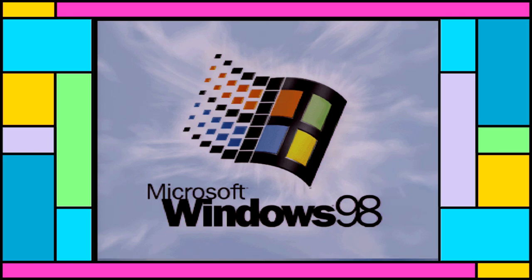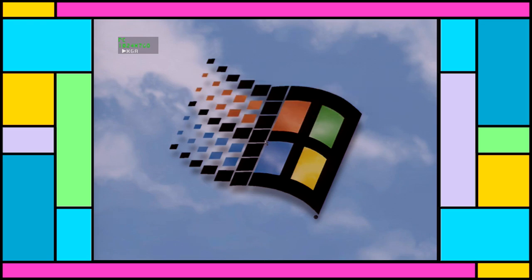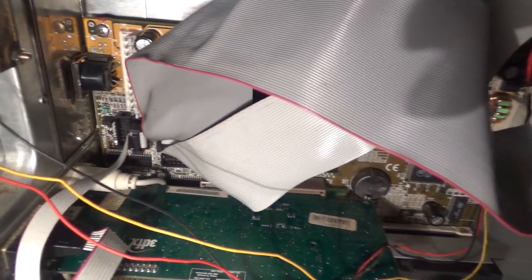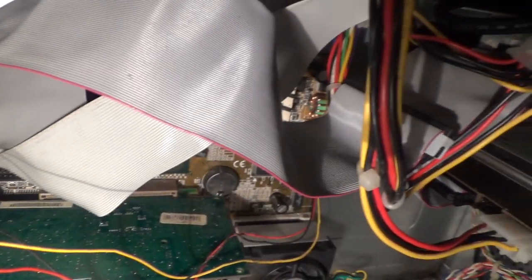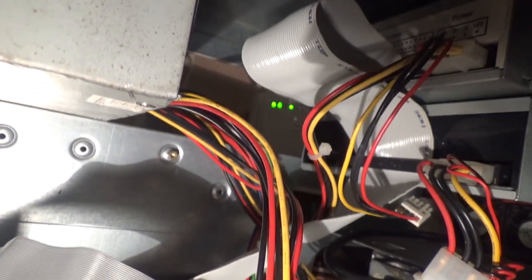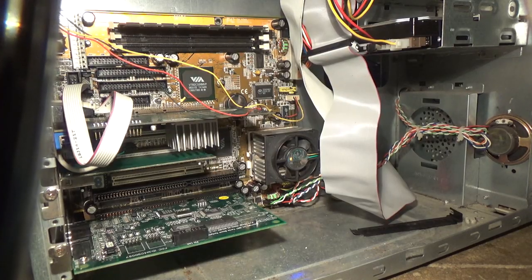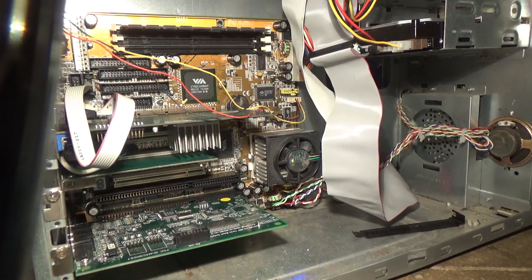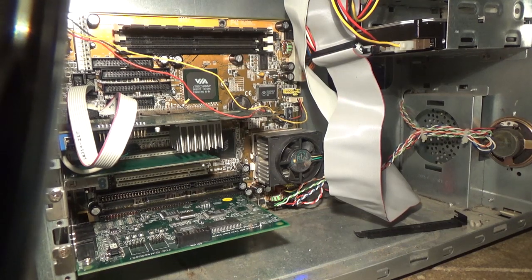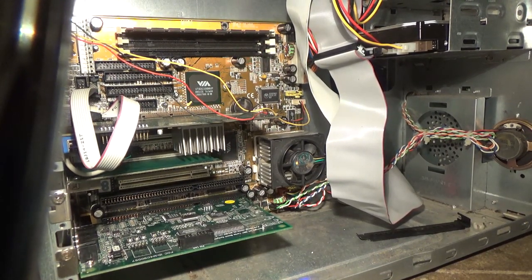Again, that's nothing eventful. Usually, but it means it's beating the TMC again, because that really didn't like booting operating systems. Actually, yeah, we're using both IDE channels at the same time, one for hard drives and one for CD-ROM drives, which the TMC also couldn't do. Hey, that's really good, isn't it? I mean, using both IDE channels shouldn't be a big deal, and this board isn't making a big deal, it's just doing what we're asking it to do and what it should do, so it's all going well so far.